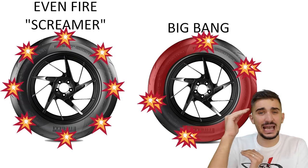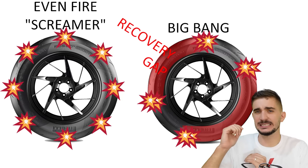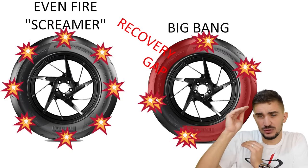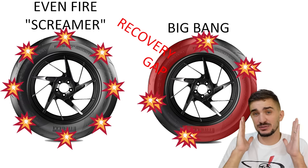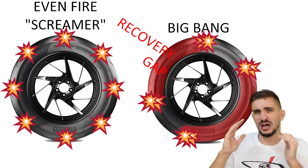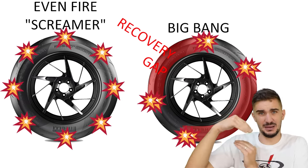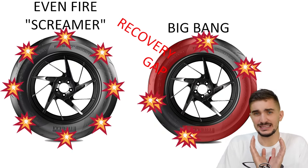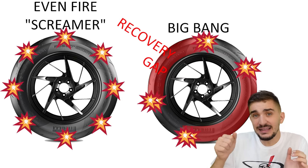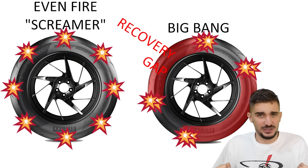Now, these silent gaps can also be called recovery gaps, and they're absolutely critical for the tire because they give the tire time and room to recover and regrip. And this is absolutely key for the rider too. Although obviously a human cannot detect a single recovery gap between two engine power pulses, they do stack up and they do create space for the rider at the limit of traction that enables him to better feel the limit of traction.